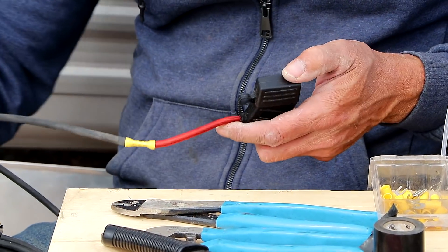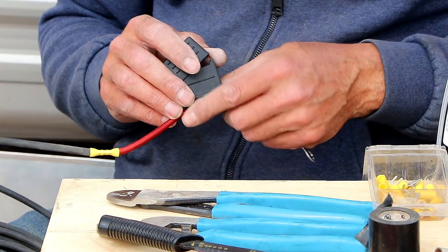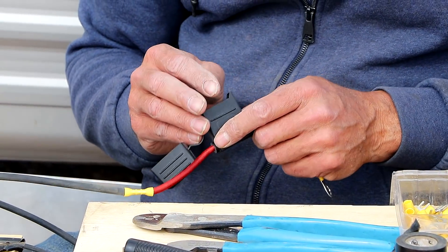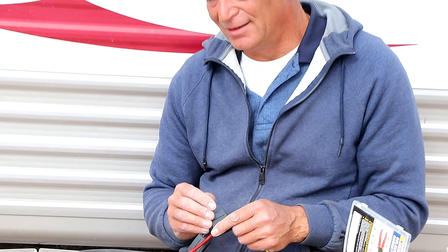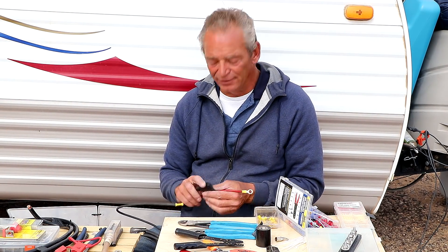And if you draw too much power, the fuse blows. You always want to keep at least one extra fuse. But if your fuse blows, the first thing is to wonder why it blew — something's wrong. Fuses don't get old and wear out and blow for no reason. You might have shorted out something. Correct the problem, put a new fuse in, and you're off.